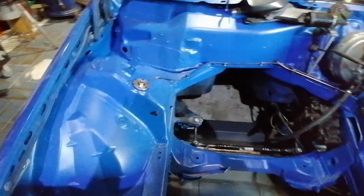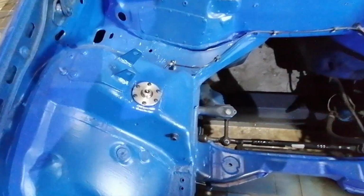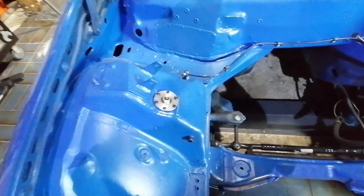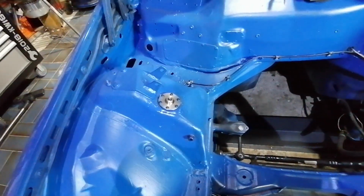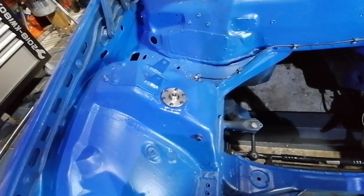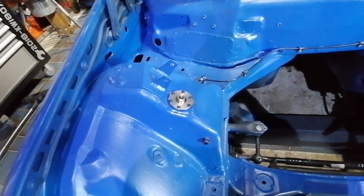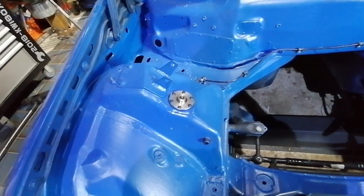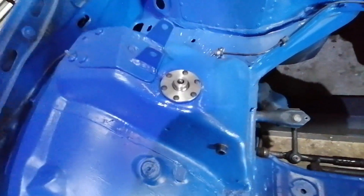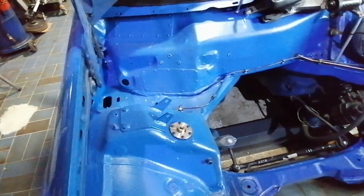I actually changed a lot on the suspension. You will see more about that when I lift up the car, but from the top you can already see that I changed the mounting point for the dampers on the chassis. Normally you have this kind of rubber sandwich which clamps on the chassis, and I switched to my own developed Uniball kit. I'm still thinking about putting this on the online shop, but this is something you can't assemble to a normal road car, because there is no space.